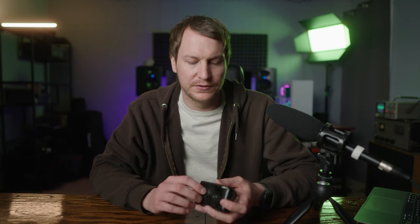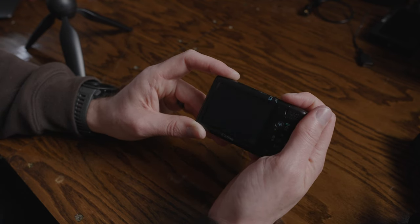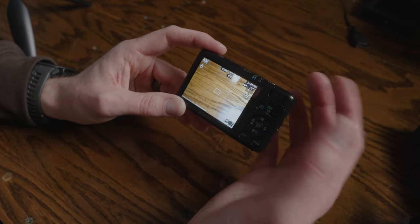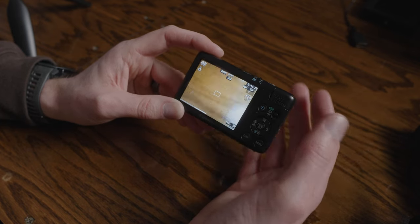Let's talk about actually using the camera because it's a fairly slow experience. The way I have this set up currently, I have to put in a cheat code to get the CHDK hack to load. There is a way around this to auto load the hack from your SD card — it's a little more involved in terms of how you set up your SD card, but probably worth it if you're shooting with this camera every day. The other thing that will slow you down is RAW capture. If I go to take a photo — 1-1000, 2-1000, 3-1000, 4-1000, 5-1000 — so about 5 or 6 seconds to actually save the RAW file. Not a big deal if you're shooting static subjects, but something to be mindful of if you're trying to capture fast moving subjects. Honestly though, I don't think it's the worst thing in the world to slow down your photography and appreciate the things you're photographing.